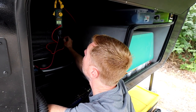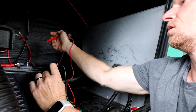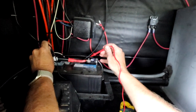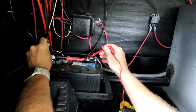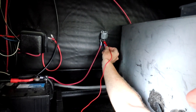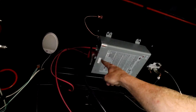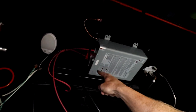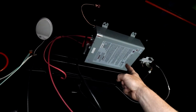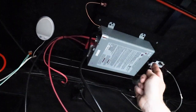We've got heat here and heat here. Right now I'm checking to make sure we have voltage all the way through. You've got your negative side over here and your positive side of the battery — this is your 12-volt side of the rig. We're going to follow that all the way up. There's a breaker here just in case something goes bad, which is good, and then you come around and go up into the inverter. You've got your red line here and your black line over there — positive and negative of the 12-volt. If all that's going in and everything's hot and this inverter is working correctly, it's going to invert. The 12-volt will go in and come out this side to make your 120-volt.